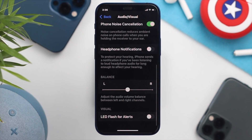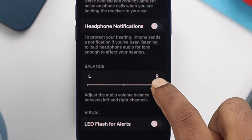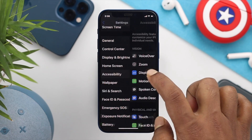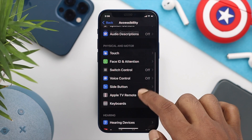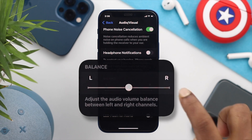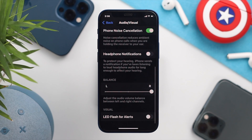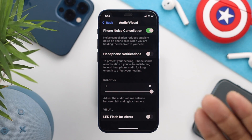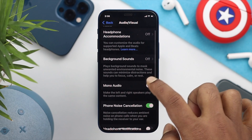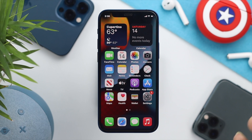You need to check the balance especially when you hear very low sound from your iPhone. Just go ahead and open up your Settings, scroll down and tap Accessibility, scroll down and tap Audio & Visual, then scroll down and you're going to see the Balance. Now if you set it to the right or the left, your speaker is going to choose only the left or right speaker to produce the sound. Make sure to set it in the middle, and after that make sure to turn off Mono Audio as well. Then give it a check to see whether your problem is solved.